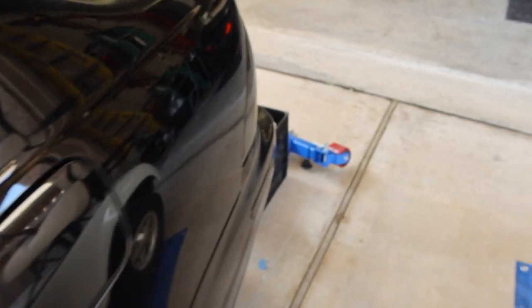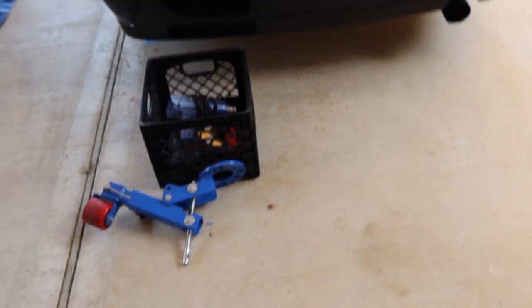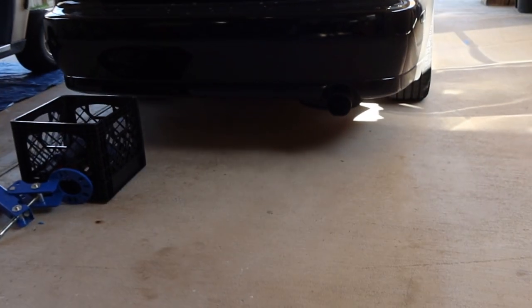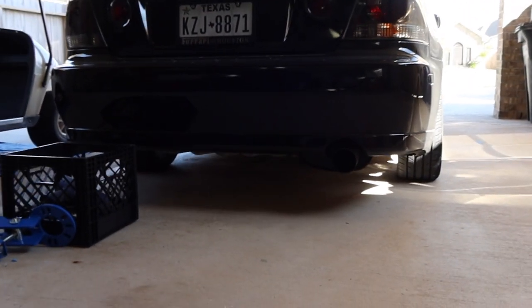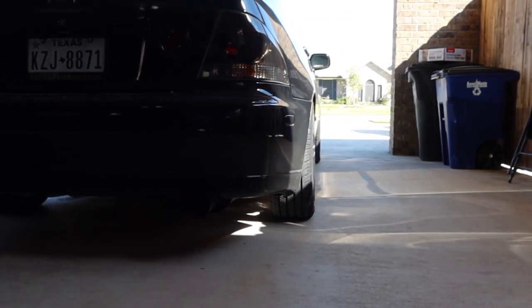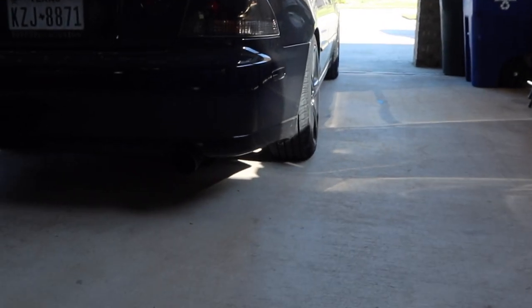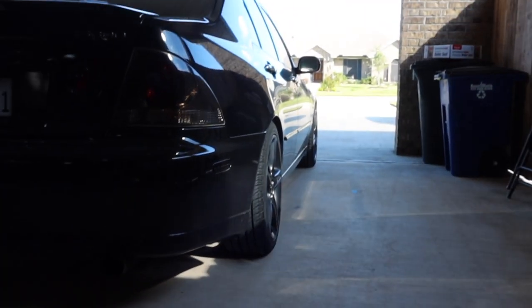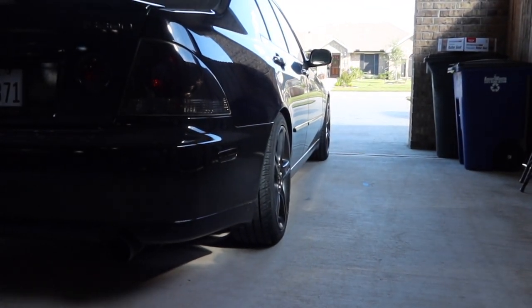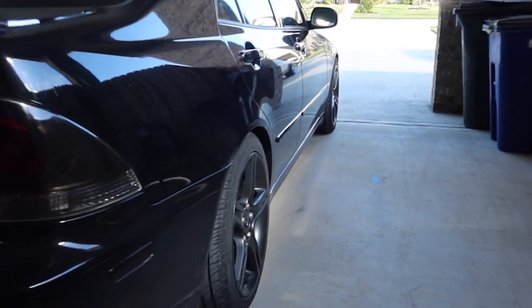And again, these fender rollers used to be really expensive. Man, they've gotten so cheap now. Anybody can pretty much buy them. You used to have to borrow them from everybody and rent them. Now you can just buy your own and roll them. It's a pretty easy process. You just heat the fenders up, attach them to the hubs, and crank away at it nice and slow. But yeah, 1 inch is where it's at.